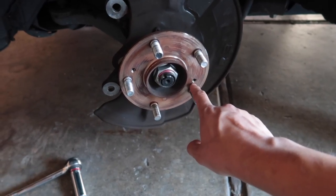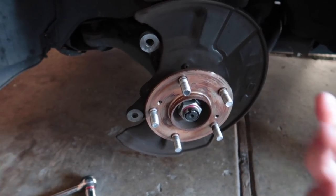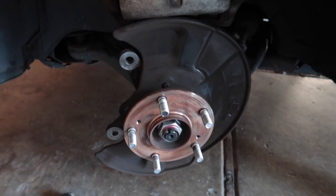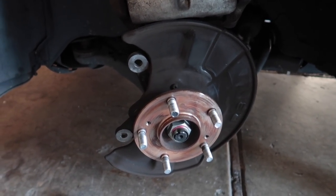17 mil bolts — they're pretty short. There are also two Phillips head screws that bolt the rotor on. Then you can pull it off and take it to O'Reilly's to get it resurfaced or spun — that's like 20 bucks. Just give them a call first to make sure they do it, because not all O'Reilly's locations spin rotors. This car is a 2013 Honda Civic LX.